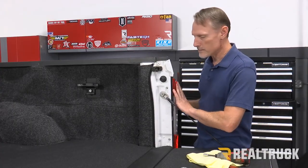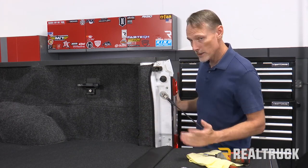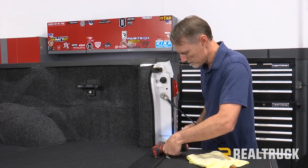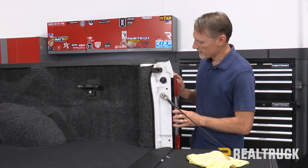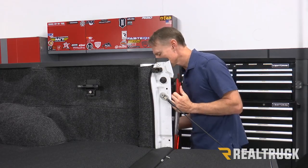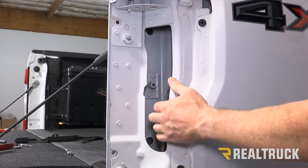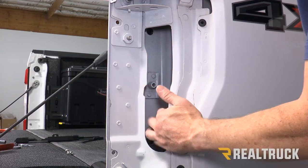The first thing we're going to do is remove the rear tail light to gain access to the holes behind the tailgate pillar. We're going to remove these two bolts with an 8mm, then pry this back using a little pry tool. Make sure you cover that up with a rag so you don't scratch your paint. I went ahead and removed the entire lamp, disconnected it, and moved the harness out of the way.